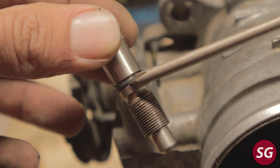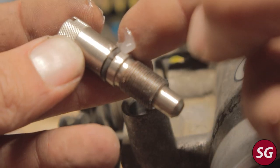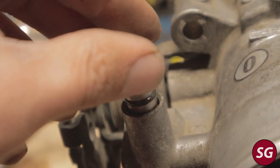It's a very nice quality piece — it has a brand new O-ring on it and because it's a little bit taller it's easier to adjust as well. Before installing, you should put a little bit of silicone lubricant or grease on the O-ring itself, and then it simply just screws in.